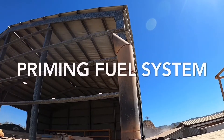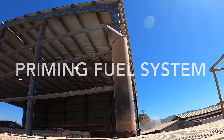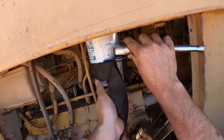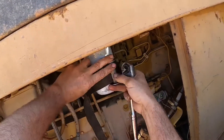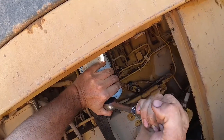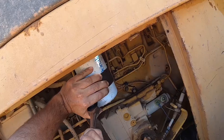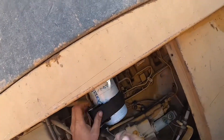In this video we use a quick and easy way of removing air out of a fuel system on a 3406C. This is a 3406C in a 980C Caterpillar loader and we're going to take the fuel filter off and tip out all the fuel and then put it back on. Run the engine and it's going to run out of fuel. This is going to simulate a situation where you run the machine out of fuel and put air in the system.